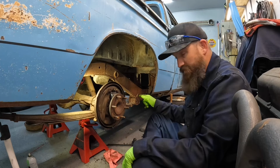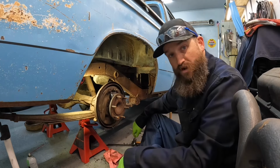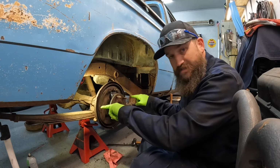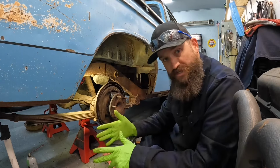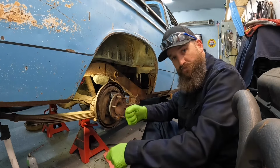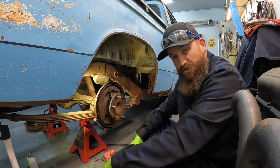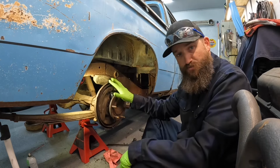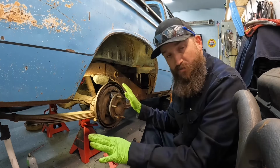And speaking of getting it done, I think I'm gonna get everything done without connecting the parking brake cable. So that means I'm gonna try to, I think it'll work, just eliminate that bar and that little spring, the lever that the cable hooks into, that when you pull the cable, it pulls that and it makes the shoe come out. I took all that off. I'm gonna put it back together without it, because I don't think I'm gonna need it for the actual rear brakes to work themselves. I'm gonna go ahead and put all this back together, and I'm not wasting y'all's time.